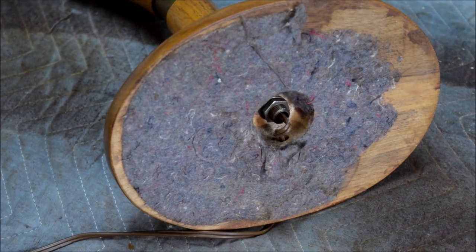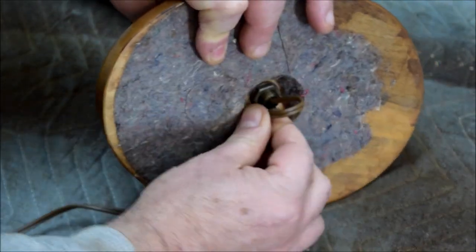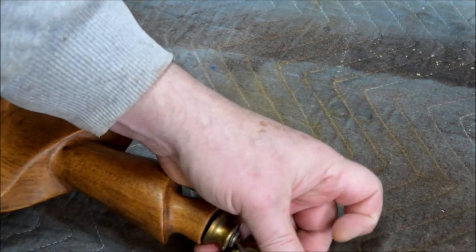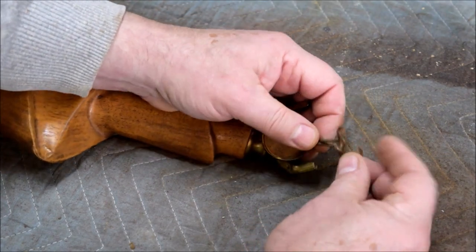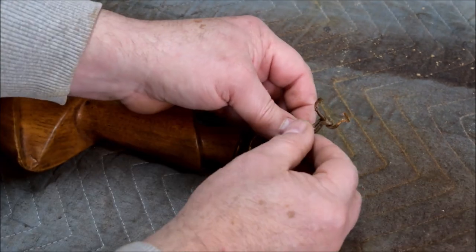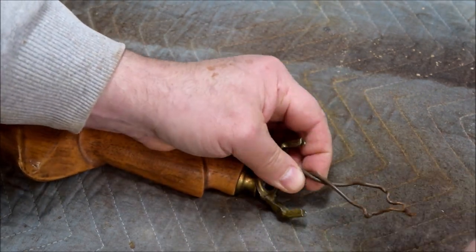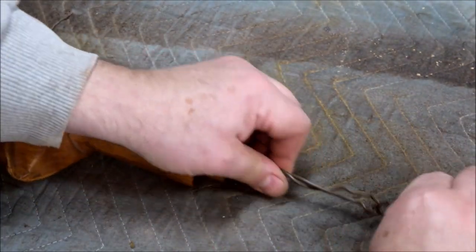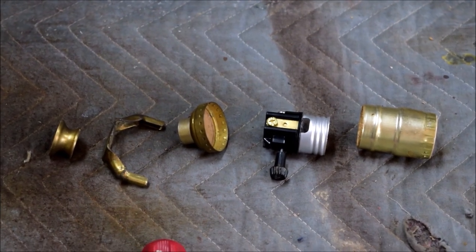In order to help disconnect the wire from the top, I'm going to feed some wire in from the bottom and pull some of the cord through to give us room to manipulate it. There's a strain relief knot here that has to be untied — don't neglect to re-knot this when you put it through, as it keeps the wires from pulling through. Off comes the socket base, off comes the harp mount, and off comes this decorative finial. I'm keeping these in order to help remember how they go on, although it's pretty obvious.